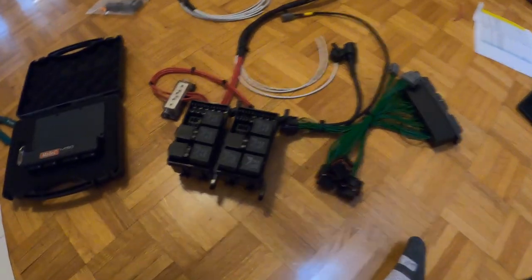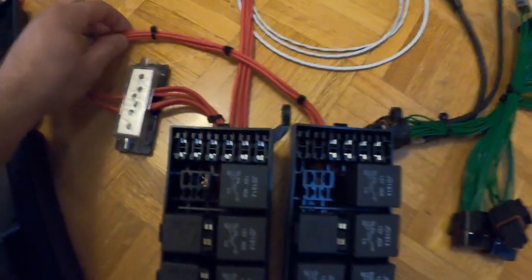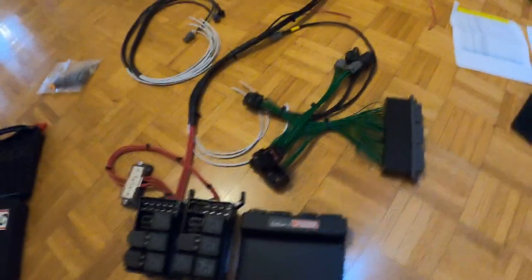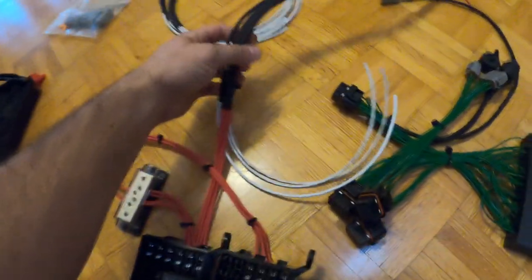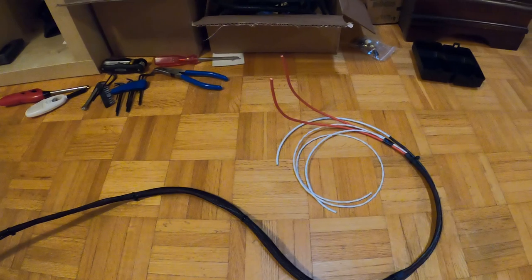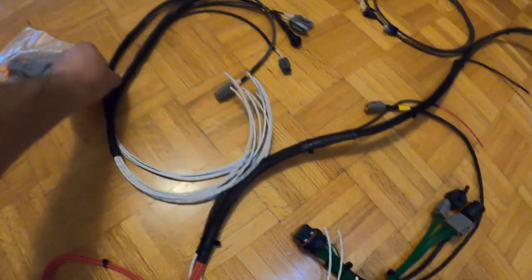It's very important that if you're going to tackle this job, you want to lay everything out on a chart so you know how it's all going to be wired up. I got these two relay boxes from ProTuners — 14 gauge wire for each fuse, all going to a distribution block with a 4 gauge coming from the battery. This is going to sit inside, mounted on a piece of aluminum where the stock ECU goes. I made these looms — one has the primer pump, radiator fan, water pump, and oil temperature.